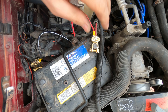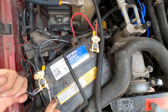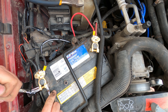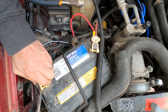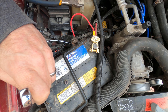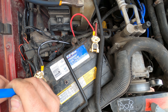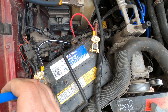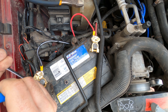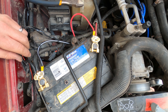Let me get this wrapped up before I do something foolish. I don't know if you can see it but this one is twisting a fair bit while I'm torquing it down. I'm going to see if I can move it down the post where it's thicker. I'm not too pleased with these terminals — explains why they were inexpensive, they don't fit this battery too well. This one was too narrow and this one was too big. Both were identical, so it gives you an idea that although the difference between the two posts is very minimal, it does add up quickly when you're trying to use generic battery posts. I'll have to either get a battery cap that gives it a little bit more meat, or find the proper terminals sooner than later.